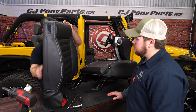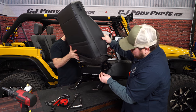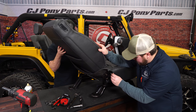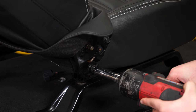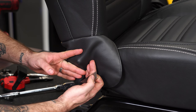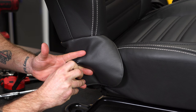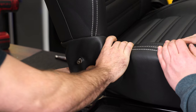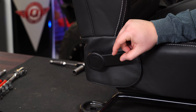Now it's time to connect the seat back to the seat bottom. There are two bolts on either side just like what we took off — pull this skirt up to see the hardware underneath. For the seat lever on the bottom, just make sure you have slack on top and bottom so there's room for the seat to recline. Once you get it poked through, make a little X incision with a sharp razor blade and pop it through. We went ahead and painted the seat lever adjuster black to match the new upholstery — simply pop it on and snap it right on.